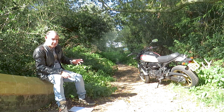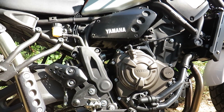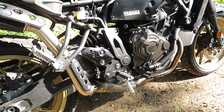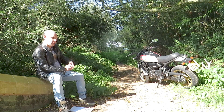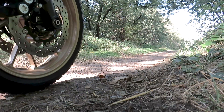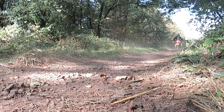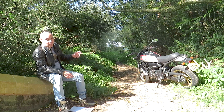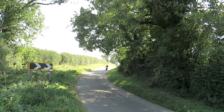First and foremost, the engine. It's the 689cc unit out of the MT-07 and nothing has really been done to it. The only thing the X-Tribute gets that the normal XSR doesn't is this rather slinky looking upswept exhaust — the catalytic converter and collector box are underneath the engine as normal, but then you've got a tall link pipe that brings the exhaust right up along the right-hand side of the seat, exiting just by your right ear. The sound is really, really sweet — it's got the 270-degree firing order engine, so the crank pins are at 270 degrees, giving it a really nice off-beat thrum, and with the Akrapovic exhaust system it just makes it sound so meaty and chunky.